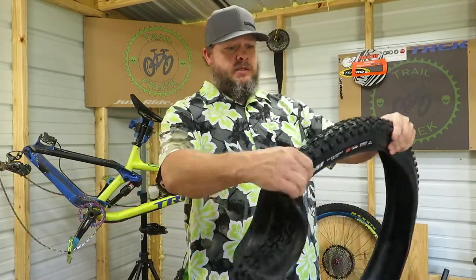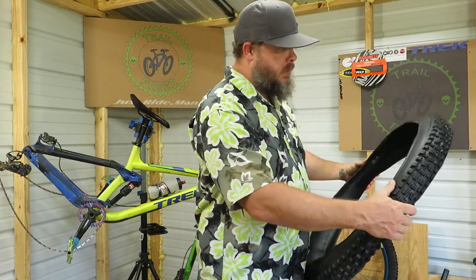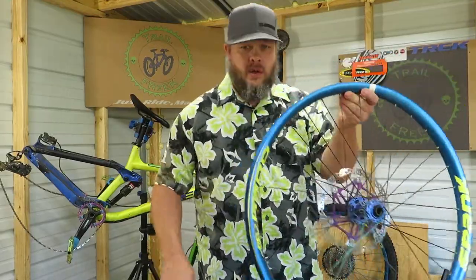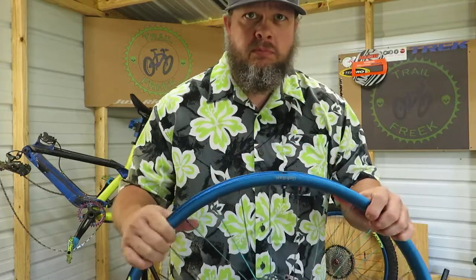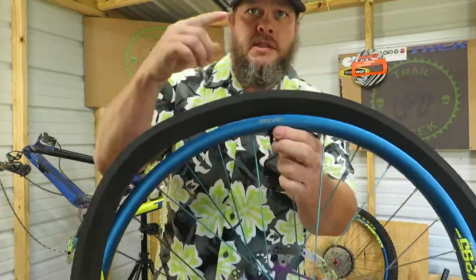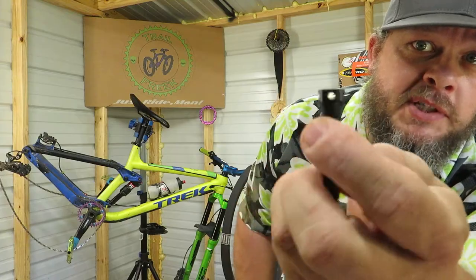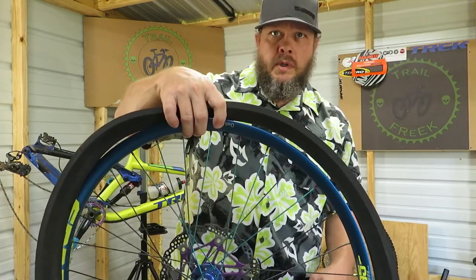Make sure you put the tire on the right way because it's got a directional arrow on it somewhere. There it is — check your rotation, make sure your orientation is right on the wheel. I already got my valve in — that came with the rim pack. It's a special valve because when the rim pack is sitting on the valve, it's kind of hard to get air in there. It's got little holes on the sides instead of the very top, so it allows your fluid or air to go through when you're putting your sealant in.